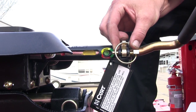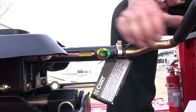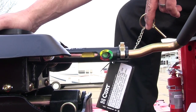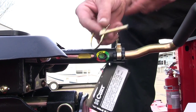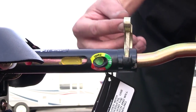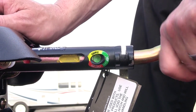Next we're going to take a look at our handle here. The handle has a pin in it. If we put a padlock in here it would lock our handle and no one would be able to release our kingpin. We'll go ahead and take our pin and clip out, set it aside, remove the lock that's on the handle now, and we can open it up releasing our jaws.